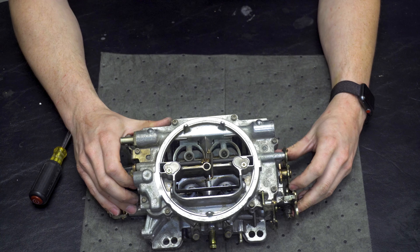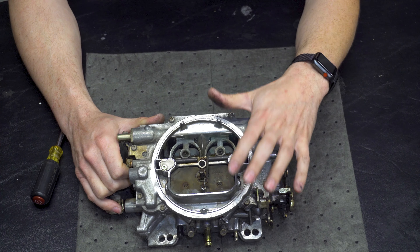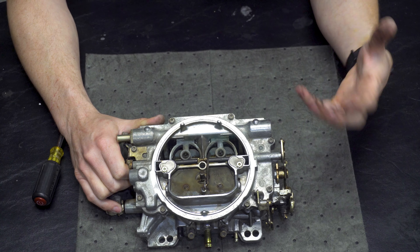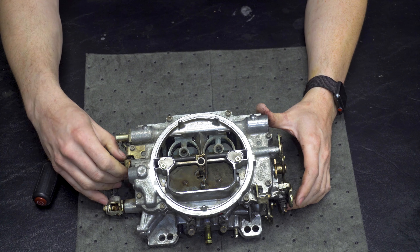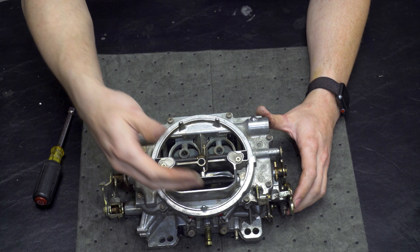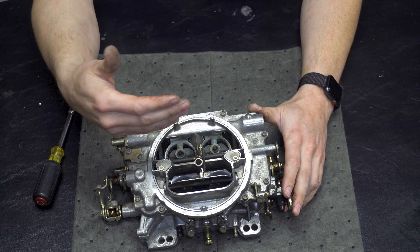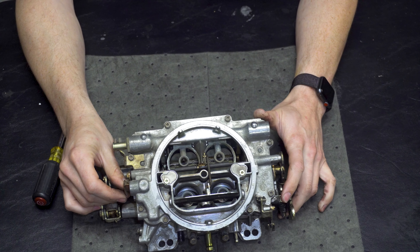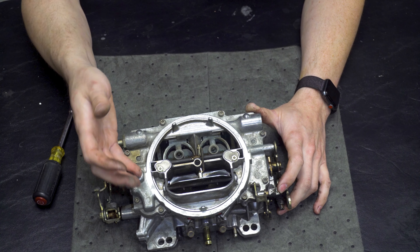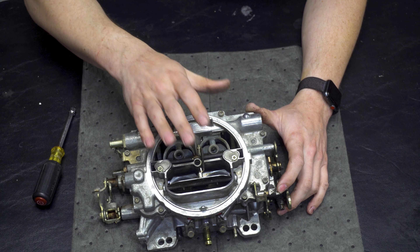One of the last things we can look at is the choke. The cool thing is we carry over the same mentality of the choke into EFI. Back in the day we would close off airflow in an attempt to enrich startup fueling — we need that additional fuel to get the motor started and warmed up. That's why on EFI we have a startup table that we normally operate off of for a few seconds or until we reach a critical engine temp, much like how these older chokes were temperature-controlled or mechanically controlled. This was a mechanically controlled choke from the looks of it. We get that initial enrichment, and whenever we reach a certain point we turn the choke off — or if it's a temperature-based or electric choke, it opens up and you get standard idle airflow. On EFI we do the same thing: we have a commanded EQ ratio where we're flowing an additional 20–30% of fuel during initial startup to get the car up and running to operating temp.